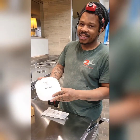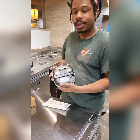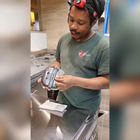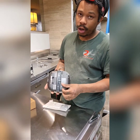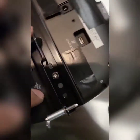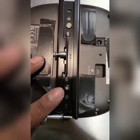On the back of this AP device we have the AP side mounts already connected. There is a lock pin and a security screw — both of these are spring-activated. The lock pin holds it in place, and the security screw makes sure it cannot walk away. This security screw pushes in and locks while turning. Both components are attached to the Aruba 500 via screws.